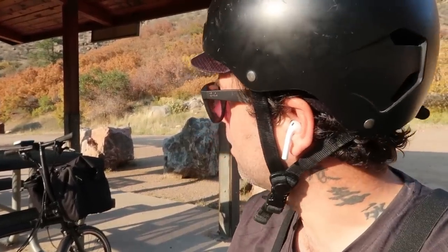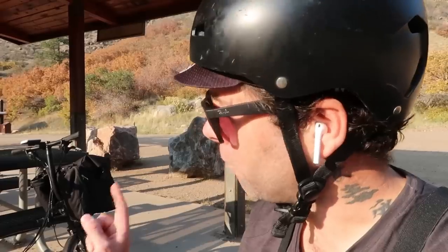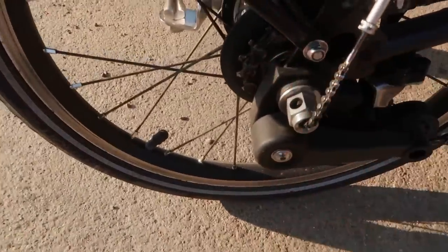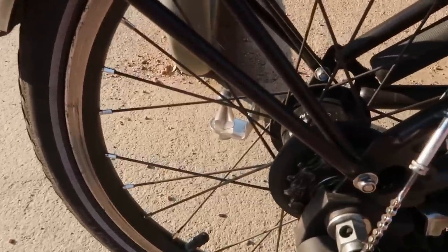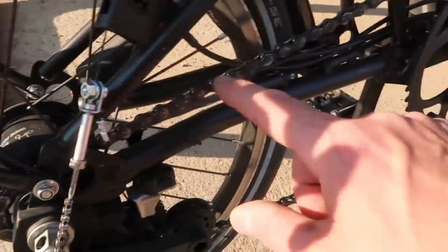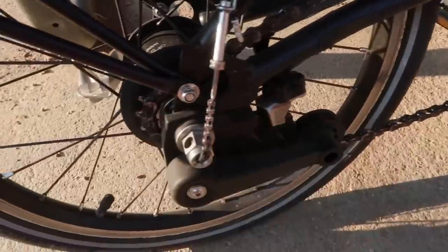And the problem is that when I'm ready to replace them, the chains get so worn that the back gears are worn. Now you guys got to figure that the back gear is under a heck of a lot more pressure. There's a lot more contact space around the front gear. The back gear, it's a little bit different. You know, you're putting a lot of pressure on those gears. And when these chain links get worn out, they start wearing the gears.